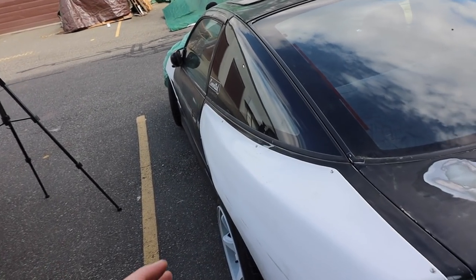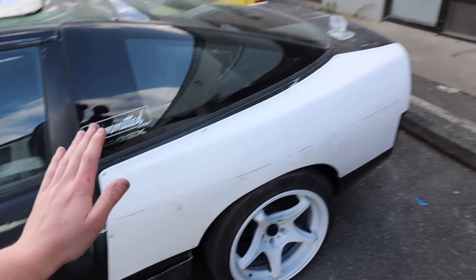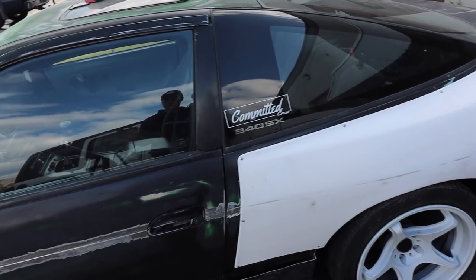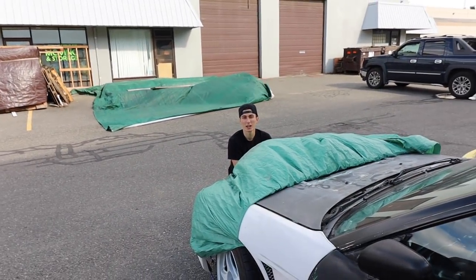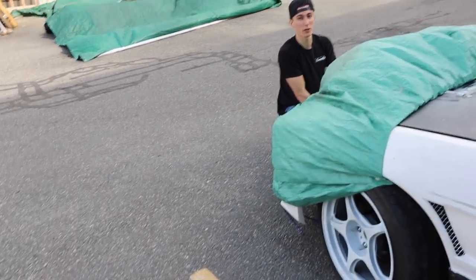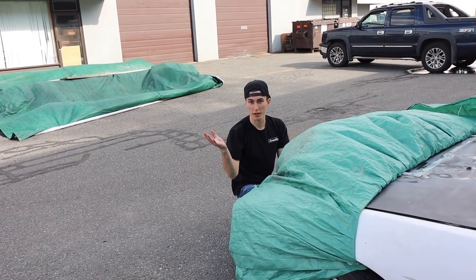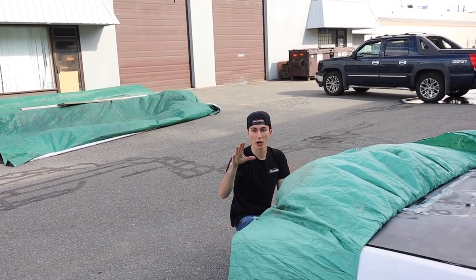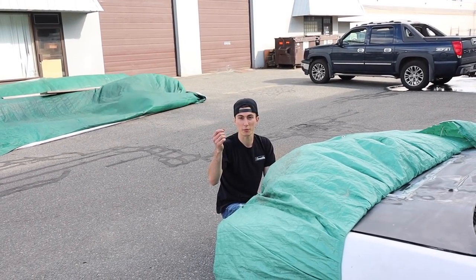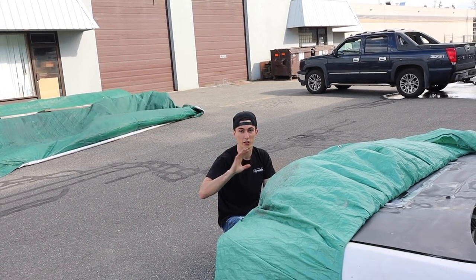We gotta take them off when we paint, just because I wanna paint underneath. And then for the finishing, we're gonna put them back over top, just so it looks complete. One of the key things, I think, you don't have to put this in the video if it's wrong, but if you paint it with the fenders on, if the fender ever shifts, if you have to take it off and put it back on, then even if it shifts a little bit, the paint can flake. Yeah, so the paint has to come all the way down, and then you put them on just for the finish so it looks exactly like it's one.